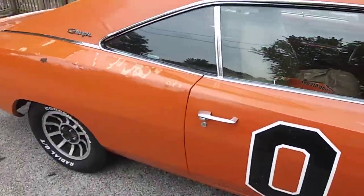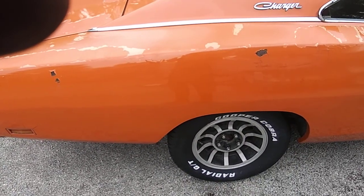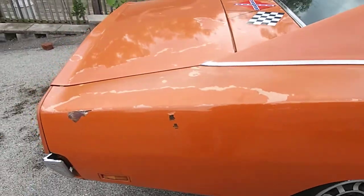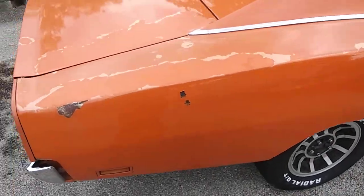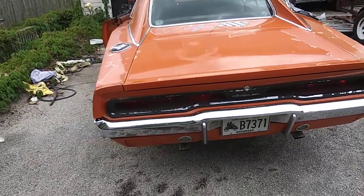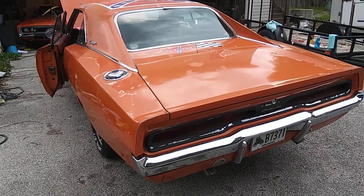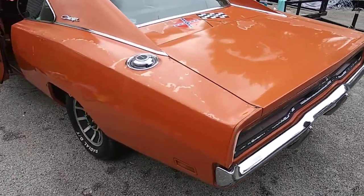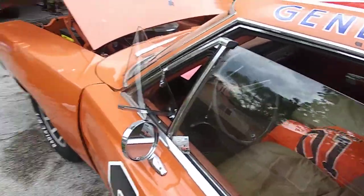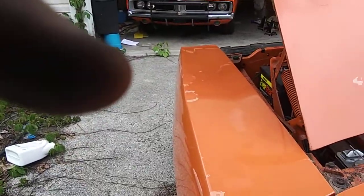it's got an exhaust leak back here, right where underneath the muffler meets the backside of the muffler where the piece of pipe comes out of it. It just rotted out, so it's got a leak. But not bad for a somewhat worn out 383 big block. I know everybody's dying to hear it. So am I.